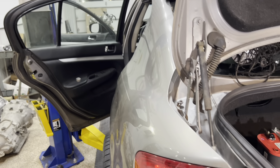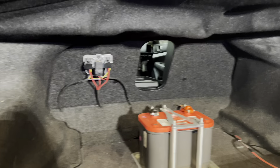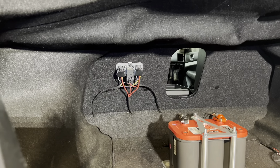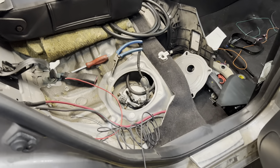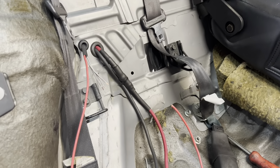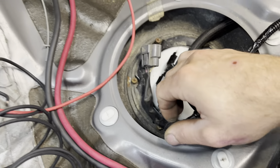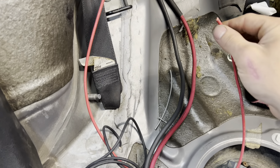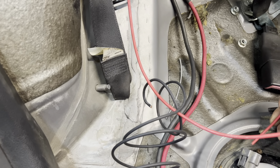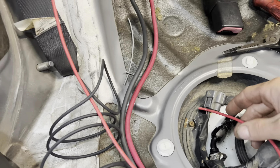Wiring is always time-consuming, but it's looking pretty good. The relay assembly for the three fuel pumps is mounted and looks great. Here we have the factory fuel pump harness and cover plate. The wire coming from the relay harness is going to be the new power feed for the fuel pump — it's going to feed the power side by splicing into this connector.